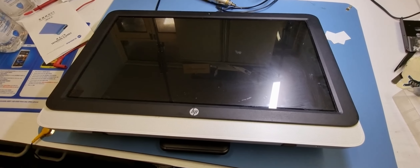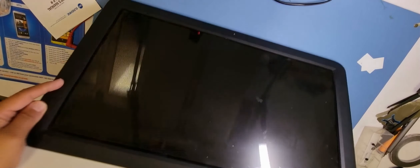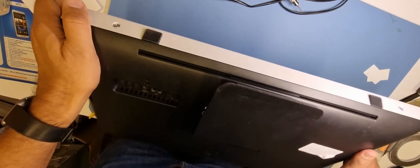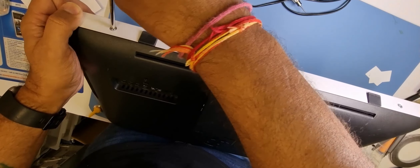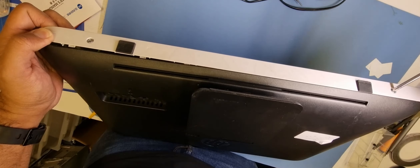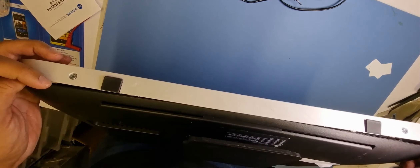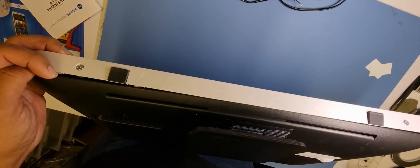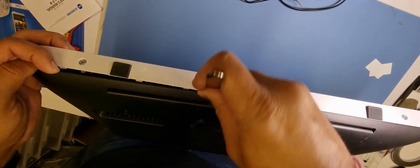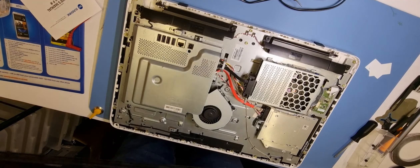To get the back off, there's just one screw there and one screw there, and it will lift off pretty easily. If you turn the screw it just pops out — you can hear the cracking. On the other side it does the same thing. You may just need a little prying tool to get in between there, and it will easily come off. There you go, pretty straightforward.